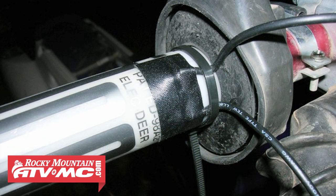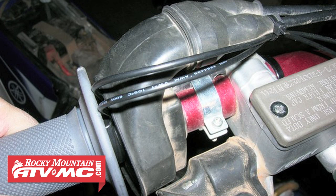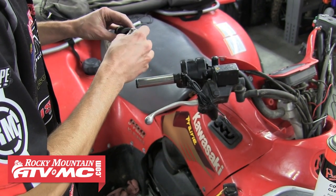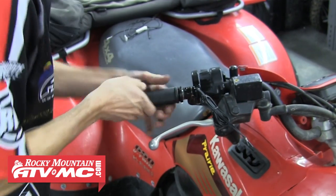When installing this on a motorcycle twist throttle, we suggest using a small zip tie to tightly secure the wires to the throttle tube. This will ensure the throttle movement will not break the solder joint. Make sure you leave enough slack in the heater wires for non-restrictive throttle movement throughout the entire throttle range. Now go ahead and apply a little grip glue onto the bar and inside the grip and then slide it into place.